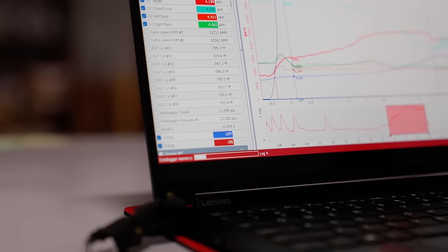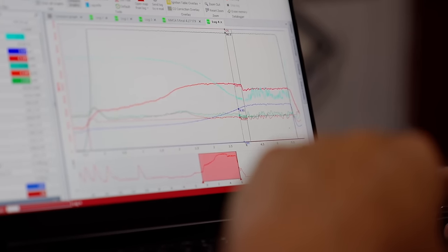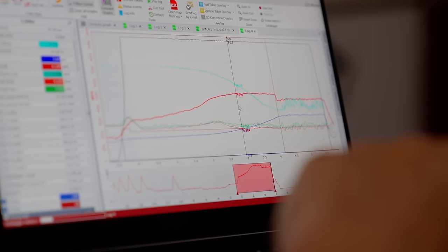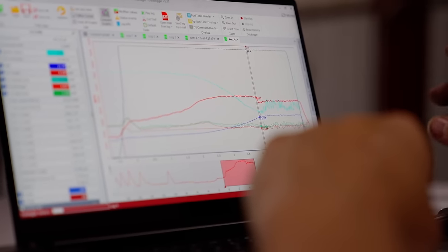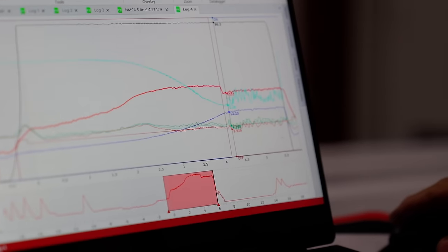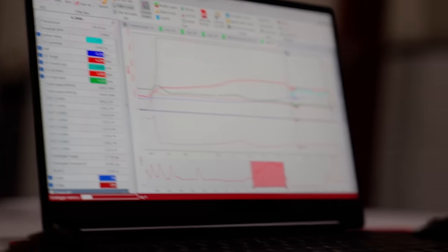Three-step is this red line way up here, and it turns off right here where the engine RPM goes down. From the moment it hit the limiter right in this area, it was only on the rev limiter for a second and a half before it built full boost, and then it drops down in engine RPM to what I want my launch RPM to be, and then it just maintains there. So I think we're gonna get the dyno wall set up, and then we're gonna make a couple pulls and see what kind of power, slippage, everything that the converter's doing.